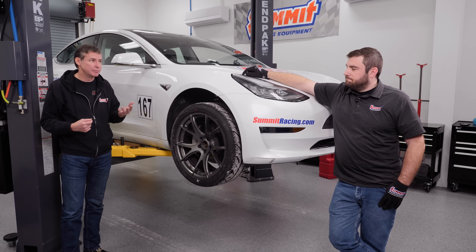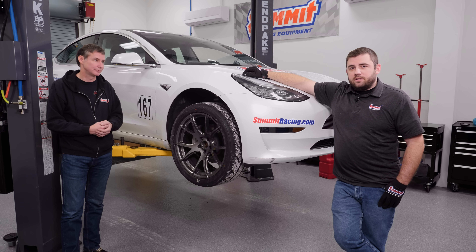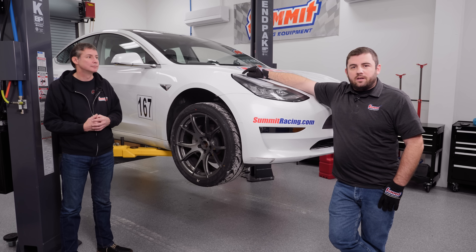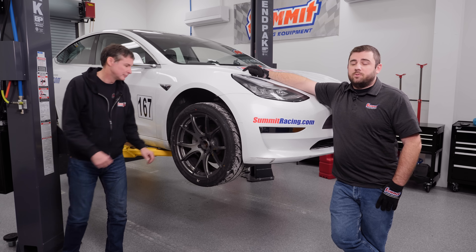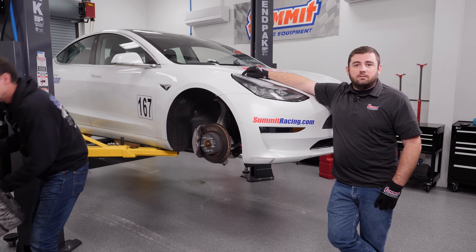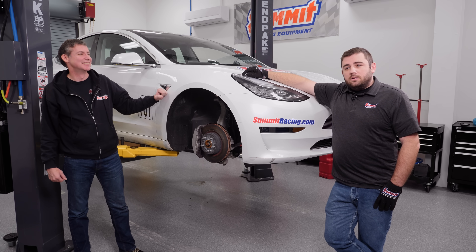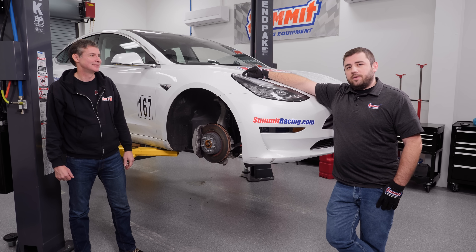We still had issues with it on the road course. Let's talk a little bit about what happened. We actually learned a lot out there since we have a few suspension aftermarket parts on here and some things don't always line up the way you expect them to. We ended up suffering an ABS wire sensor failure, which as we found out disables quite a bit on the car, including regen braking, traction control, stability, and power steering — which is a great way to find out in the middle of an autocross course. We can take a look here and see how we might be able to avoid those failures in the future.